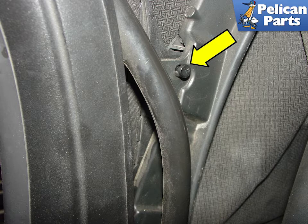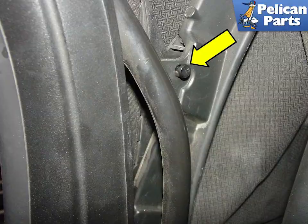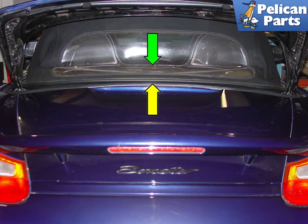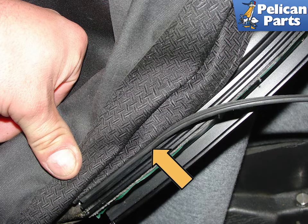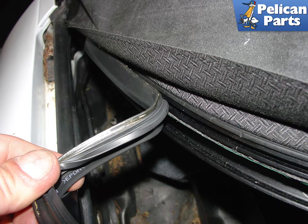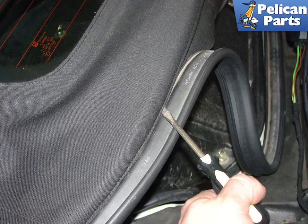After the slider pieces are installed, reattach the roof cable using the screws removed earlier. Move the roof back to about 18 inches open. At the rear of the car, measure the center of the window and the center of the rear channel, and mark the liner and channel so you can line them up during the next step. Apply double-sided adhesive tape to the rear channel in the same manner as when you removed the old top. Lining up the rear and making sure it's centered, feed the top material into the top of the rear channel, keeping the seam aligned slightly low along the edge of the rail — otherwise the seam may be visible when the top is closed. Use a small rubber hammer to tap in the locking strip (orange arrow), then reinstall the rear weather stripping into the middle channel. Reinstall the thicker seal into the lower channel — double-sided tape was used, but the seal repeatedly fell out when the roof was raised and lowered.